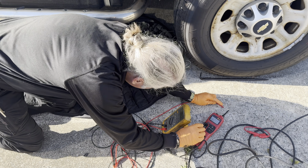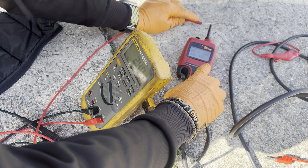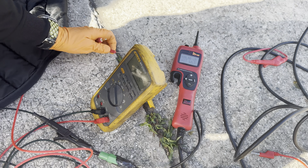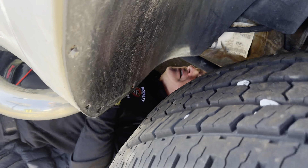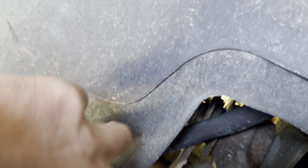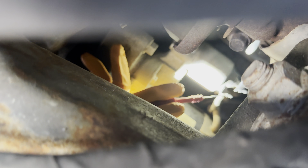All right, let's go right back to where we were. Let me get my light and figure out where I'm at. I'm going to go first to the little exciter wire. Go ahead and try to crank it — hold it in the crank position. All right, we got 10, 11 volts — 11 volts. All right, let off. So we got 11 volts at our exciter wire.